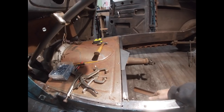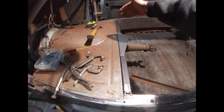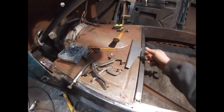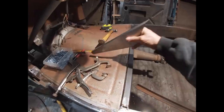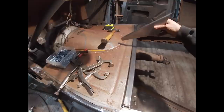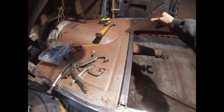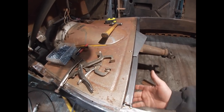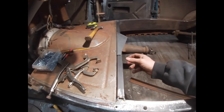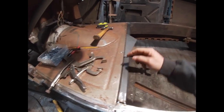Moving forwards, I'll make sure I have a spacer in between this section here and over on the passenger side, because I'm going to have to cut the other piece of metal, the one by stock that's under here. Probably right around where this screw is, and the next piece is going to come down and meet it here. I need room for my shifter and my shift linkage. I think this piece right here above the shifter where I notched it is going to have to be removed. Then I'll make sure I have my steel in place, I'll have a spacer in here also, and then I'll tack weld these two box tubes underneath. So this portion isn't just standing alone by itself. It'll actually be welded to the structure going across, tying the frame rails in. And then I'll be able to build my box going forwards, obviously not to impede the pedals.